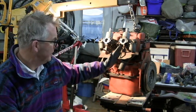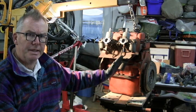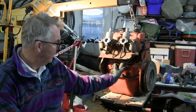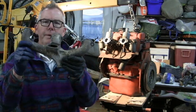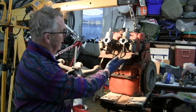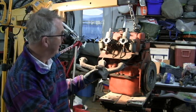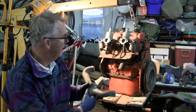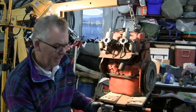I need to do something about this exhaust. As you can see the exhaust is going this way — this is the front of the car, this is the rear — and it's slanting down this way, but it should be slanting that way on a Morris Minor. This is also a wider exhaust manifold than the 948. The 948 exhaust manifold slopes down towards the flywheel, whereas the Austin-Healey one goes the other way. So my standard exhaust, which I bought for the car, won't quite fit. It's either using the 948 manifold, which would be slightly restricted, or getting a 1098 exhaust that will work with the existing exhaust system. Got a little bit of thinking and planning to do with that.